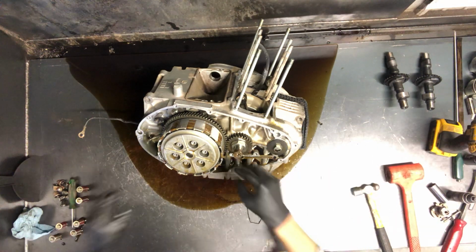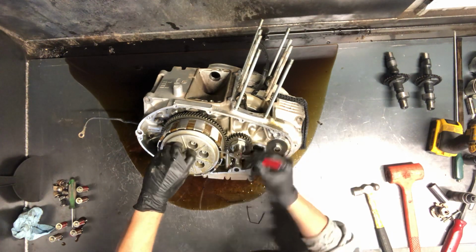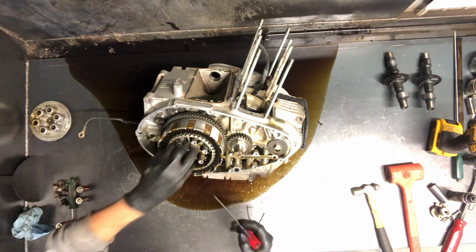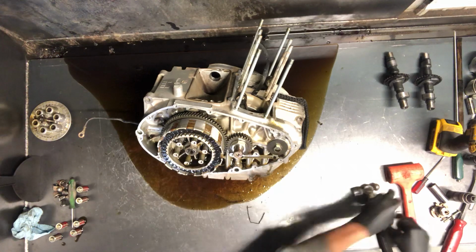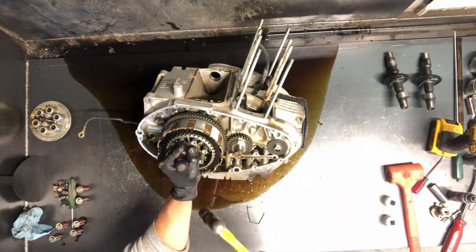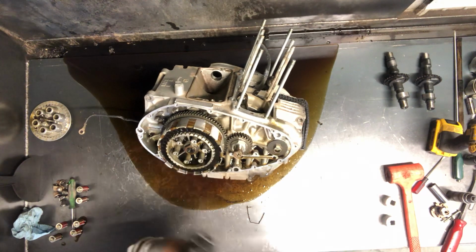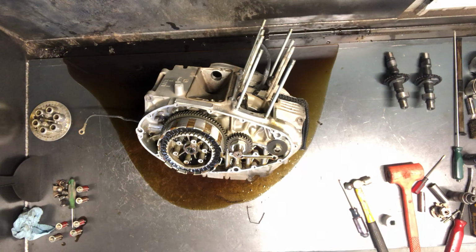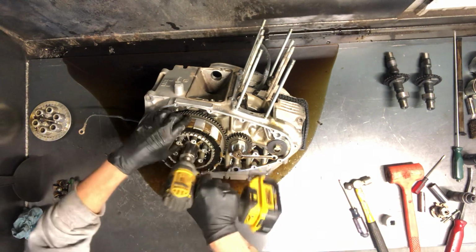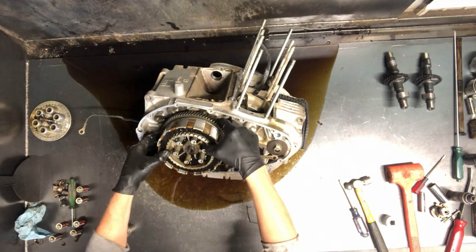Clutch hub will come off here. You can just pull this up. Once you get that pulled up, you can pull that bolt off. There'll be a nut in behind there. We'll flatten out this keeper. Inch and a 16th. I'm gonna keep that from spinning. Now the entire pack will come off.